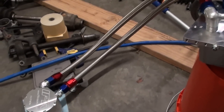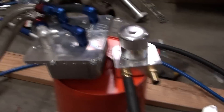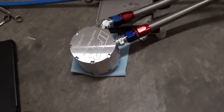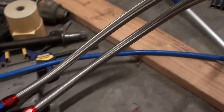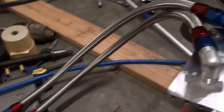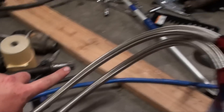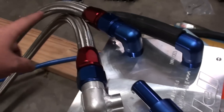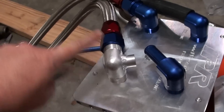I don't really have anything else to show you as far as work goes, but I did read over the directions and figured out how this is all going to hook up. Basically, this is the new IPR top cap that goes on top of the oil filter and replaces the oil filter with theirs. It has an in and an out where it's going to send the oil, and that's what these stainless lines are. These look really nice sitting on top of the engine. The oil will go out and come up to the remote oil cooler — the little bracket they have with the cooler on the bottom. The oil will come up into the top side facing the sky, and then go back in through the engine how it's normally supposed to.